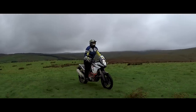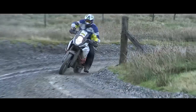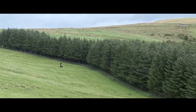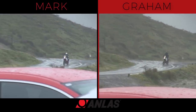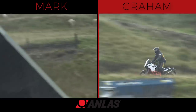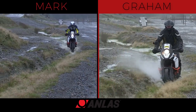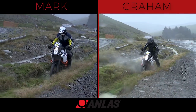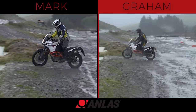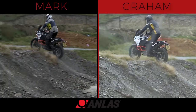Mark and I come at this from very different angles. Mark's the instructor, the lifetime enduro and motocross rider — used to going fast with lots of grip. I spend 95% of my time on tarmac and 5% off-road. With the hard tyre pressures it felt very woody, the suspension felt harder, no give in the tyres at all. Lee's knocked them back down to 25-20 PSI and there's a lot more feel, the bike stops faster, a bit more grip, and it actually steers more accurately. At trail ride speed they are really good — very impressed. On the road the same: very good.